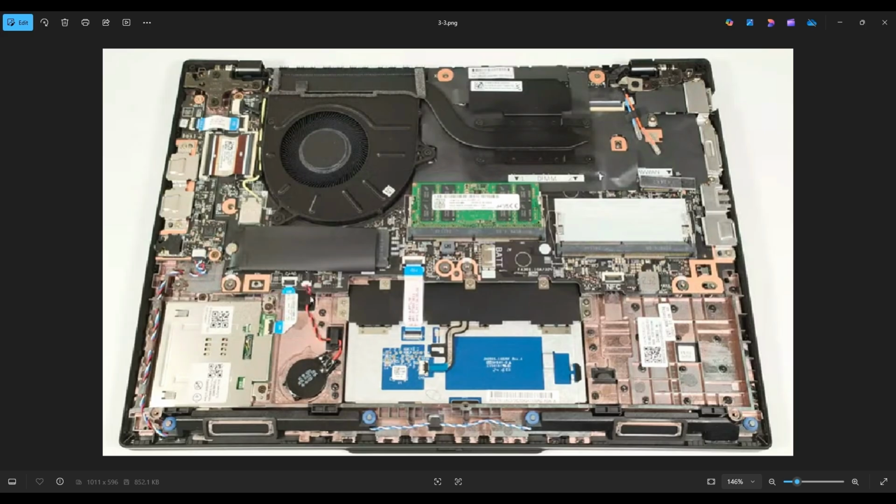If you're here to reset BIOS, you don't need to necessarily take that battery up. You can leave it down. Just unplug it from the motherboard for 15-20 seconds. That should be sufficient to reset your BIOS system settings. Again, as with any cables, do not pull on the wire. This can come out of the plug. Just use your fingernails or a pry tool on the grips on either side of that plug to wiggle it out of that port.